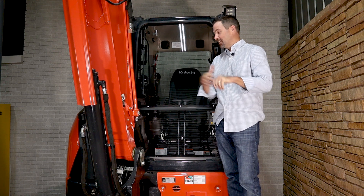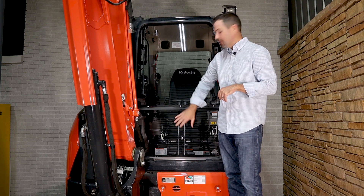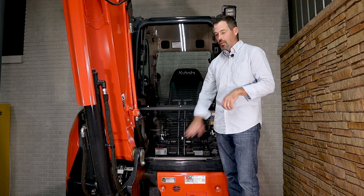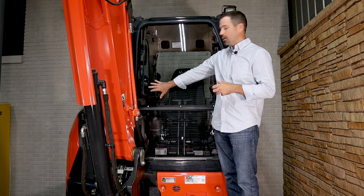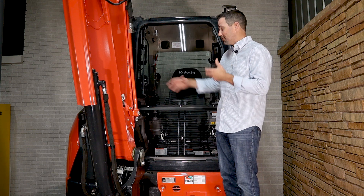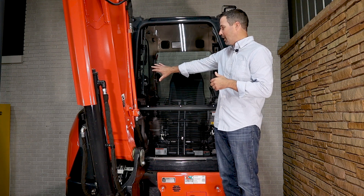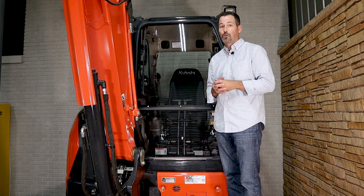Let's take a closer look at the construction of this new design. We have the upper poly and the lower poly — both made of half-inch dual-sided scratch-resistant polycarbonate. The lower just slides right into place, so if you bust a lower glass, you can replace it with our half-inch, no problem. The upper is held in place by our mechanical fastening system. Most of the time people want you to polyurethane it in like an automotive piece of glass, but the problem is you have to question the structural integrity of that polyurethane on polycarbonate. I've seen a lot of them start to break apart, and then it works its way around the windshield and you have one in your lap — not a good deal. So we use a mechanical fastening system: you tighten the bolts down, you know it's not going anywhere.